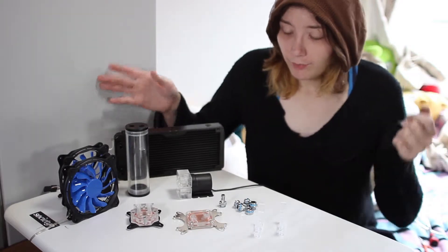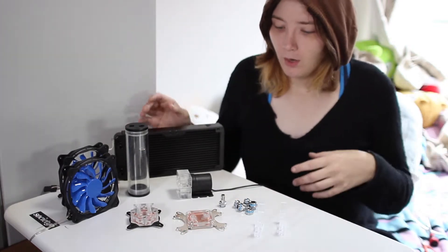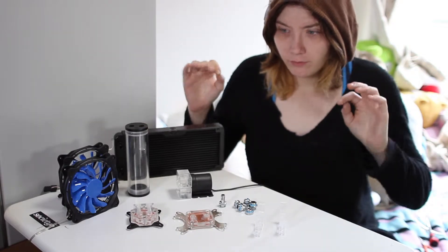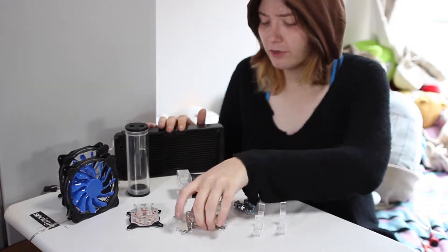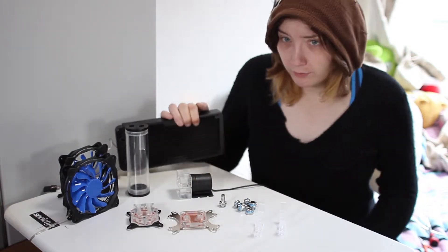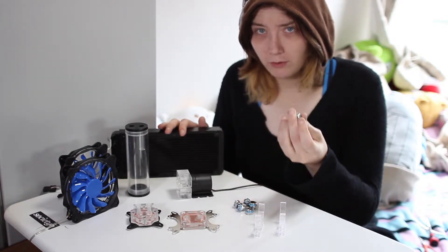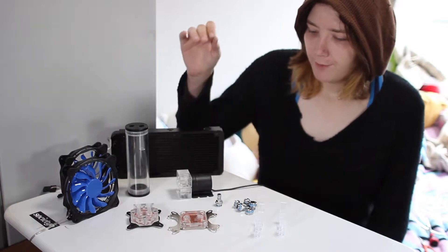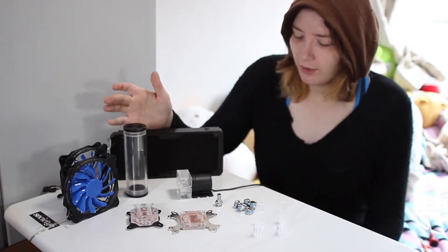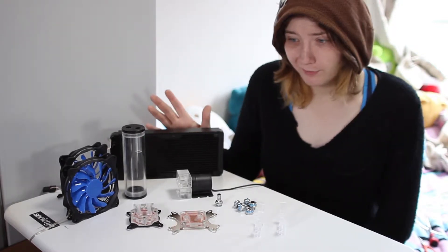This is a whole kit, but it's a Chinese kit — there are no manufacturer labels, no warranty slip inside, nobody to call, and nothing is guaranteed. Also, because the blocks are copper and the radiator is aluminum — and I'm about 99% sure it's aluminum — you're going to have galvanic corrosion to deal with. If you do end up getting this kit, just get some anti-corrosion additive you can put in the water to stop or at least slow down galvanic corrosion. I didn't do that for this review since it won't be in there long enough.